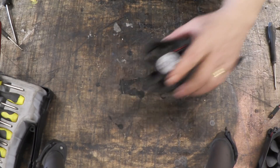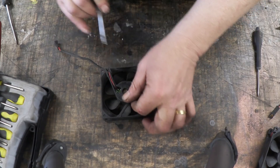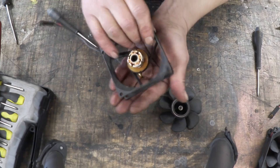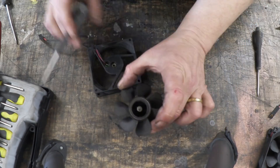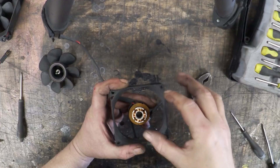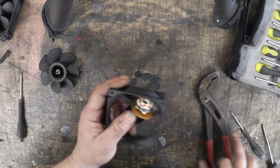First thing: remove that label. When you get the label off, you'll see a little plastic washer which you need to prise off — it's got a split in it. Prise the washer off, and that's the spring clip that holds the whole thing together, and then the fan will come off. Just check there's nothing else in there — sometimes there's a rubber O-ring, sometimes there's a little washer. In this case, we've got a bearing and absolutely nothing.